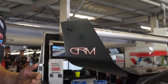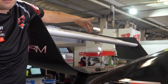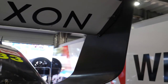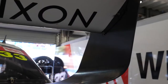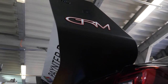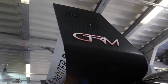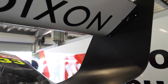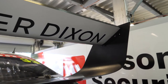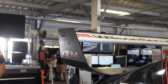There are a few different ways you can mount a wing on a supercar. You can mount from the centre here off a pylon, or you can mount on the endplate. It's actually not that common to mount a wing on the endplate, but there's a very important reason that we do it. As the cars are cornering, the wind comes and hits us from the side, which generally makes the car draggy. The endplate returns stability to the car — think a wind vane or a dart — it pulls the pressure rearwards on the car and helps the car stay nice and stable at high speed.